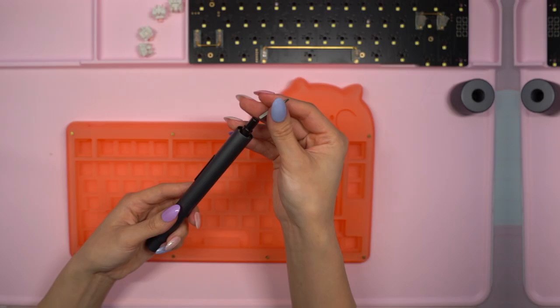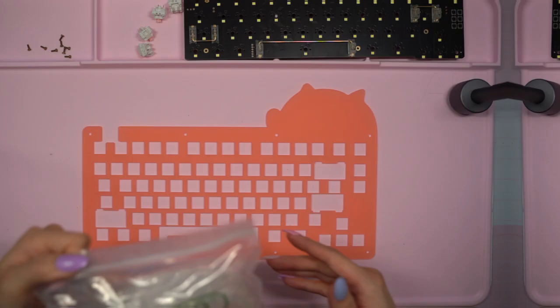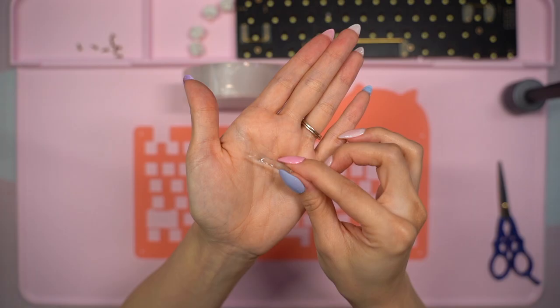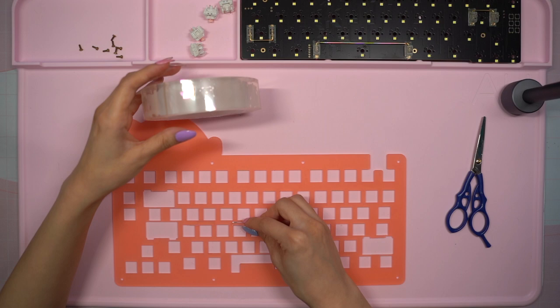Next I'll be removing the plate from the case so that I can add my switches to the build. I used my WowStick again to remove the top screws from the standoffs holding the case together and put everything to the side except for the plate. This case does not come with gasket strips or plate foam, but I was recommended by Awesome Keyboards to use a clear double-sided tape. It's two millimeters thick and I just cut a thin strip off of the roll and leave the clear film in place — I only need it to be sticky on one side. I want to add the tape to help fill in the space between the plate and PCB so that when I add switches, the plate doesn't flex and will remain sturdy. I usually would add plate foam but this is a nice alternative since it's clear and the right thickness.